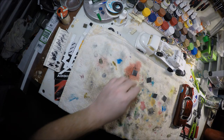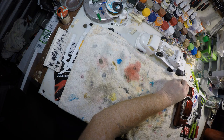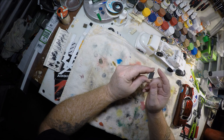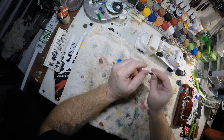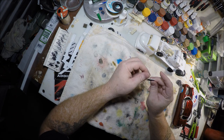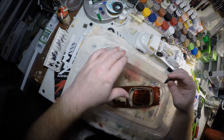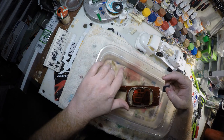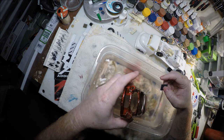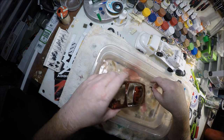I've got to get my water ready. I don't let these soak in water because they will come apart. But if you're just dipping it in and rubbing — dipping and rubbing — you'll wear out the sandpaper long before it comes loose. I put a couple of drops of dishwashing liquid in the water so it breaks up the surface tension, slides a little easier, and stays on the car a little better.